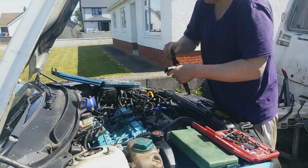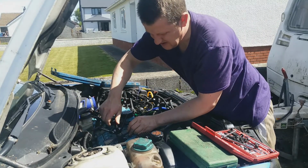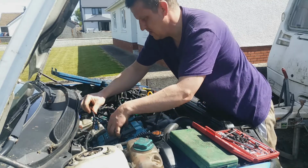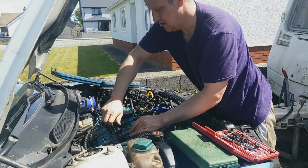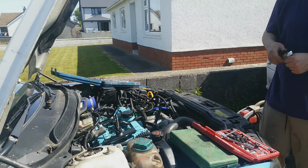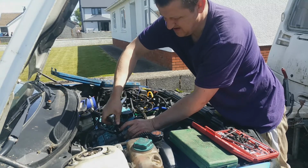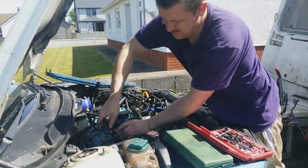Careful with these tools, because they're going into your spark plug threads, and you don't want to ruin your spark plug thread. And always try and remove your spark plugs whilst the engine's hot. Oh, it stops them being so tight. Because I had to get another head when I had a spark plug cross thread and not remove, and then tried to put a remover tool in, and that snapped as well, so I just ended up getting another head.